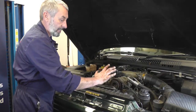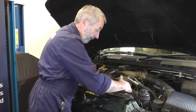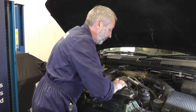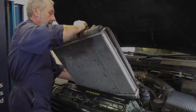We're now going to lift the radiator out. Those two M8 bolts that we took off at the bottom of the radiator are the locating bolts. After we've got the hoses off, there are a couple of oil cooler hoses on the cowling, so just as you lift the radiator up, make sure they are clear of the bracket and then that's the radiator out.